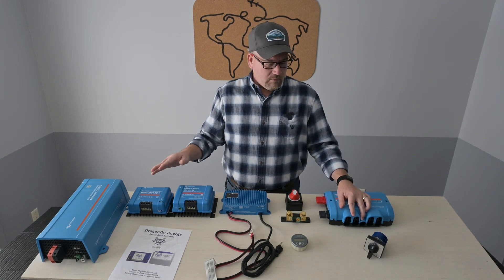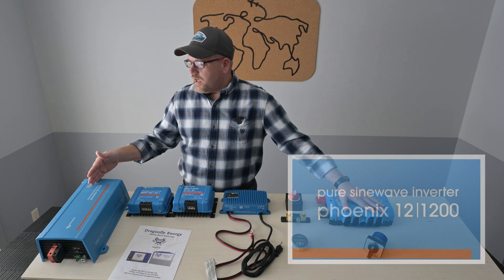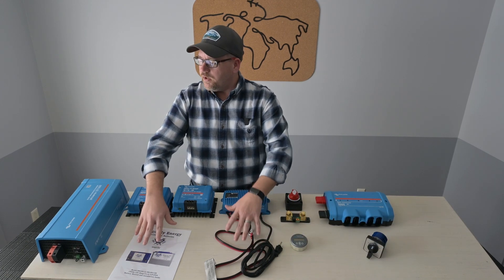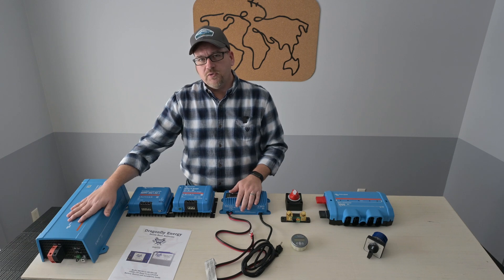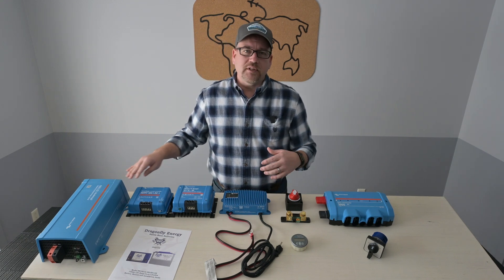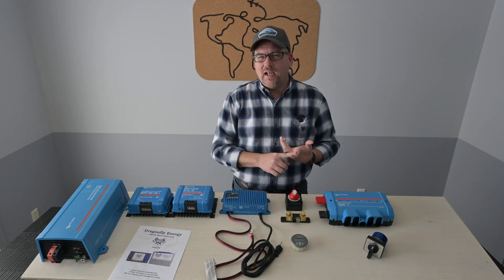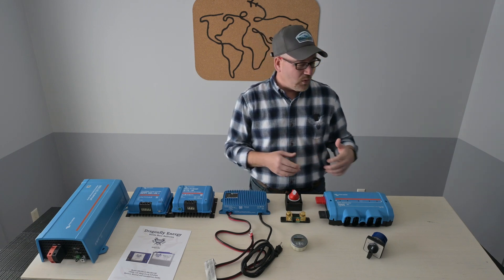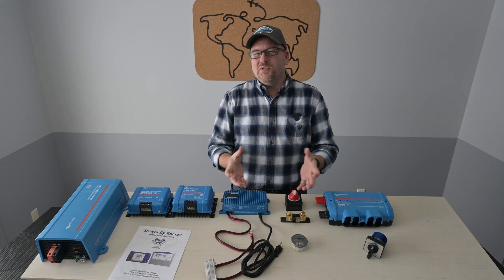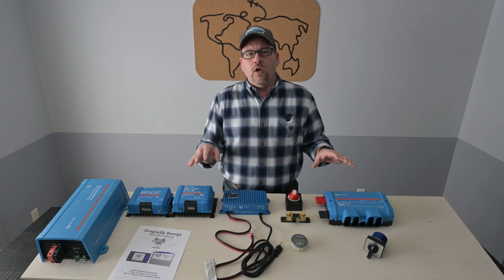I'm going to go over the components — first, over here to my right, your left, is the pure sine wave inverter. This is going to take our DC from our batteries, which will be situated here once mounted in the truck. We're running a 12-volt system and this is a 1200-watt continuous inverter to make our AC to run our laptops and things like that. On the DC side, most of our lights are going to be LED, we've got some fans, and for those DC circuits what's not yet on the board — going somewhere here — is a small automotive distribution panel.